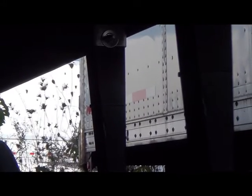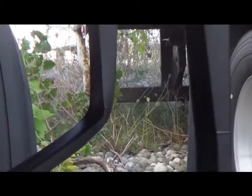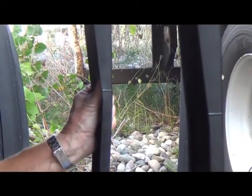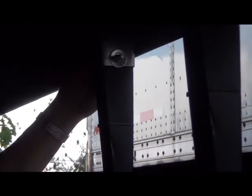Solid, and it's designed for the bottom part of the skirt to bend if you hit an obstruction. Here is the next bend point that lets you give plenty of clearance and it will still find its way back down straight. But this part is totally protected with the plate and the hook and the J-bolt.